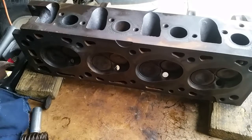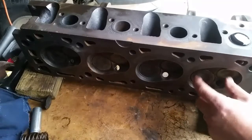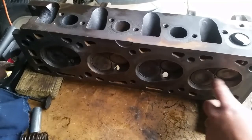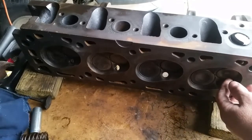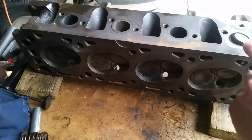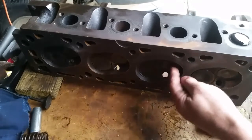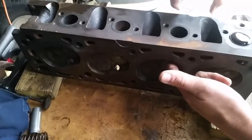All you have to do is take plain faucet water and pour it right into the ports. If you were to fill the whole combustion chamber with water, you wouldn't know exactly which valve is leaking — especially if it's just barely seeping or leaking real slow. This way you know exactly which valve it is: this valve, that port; this valve, this port.